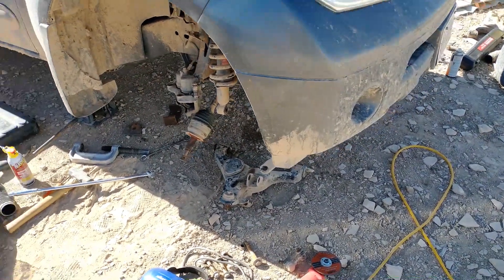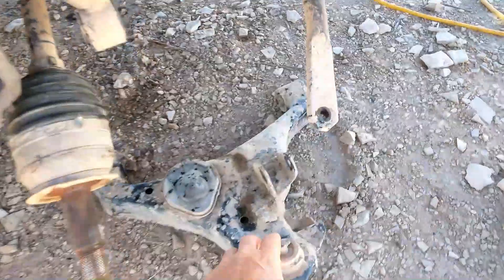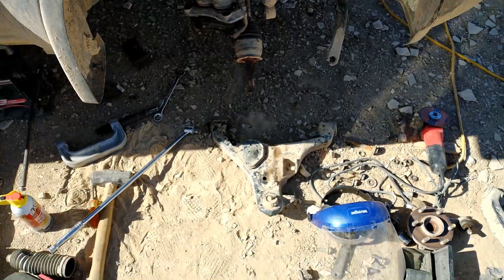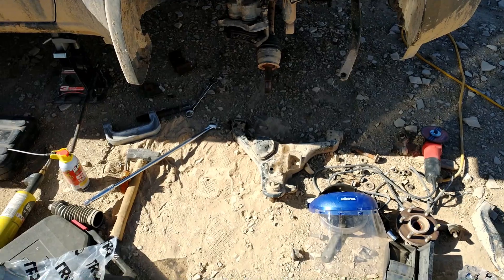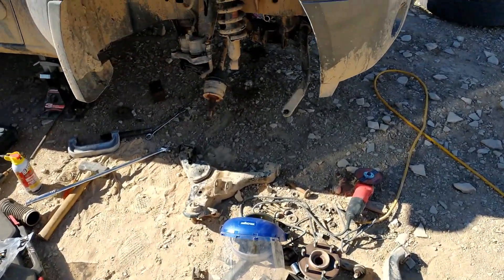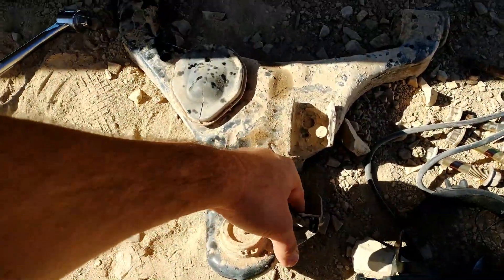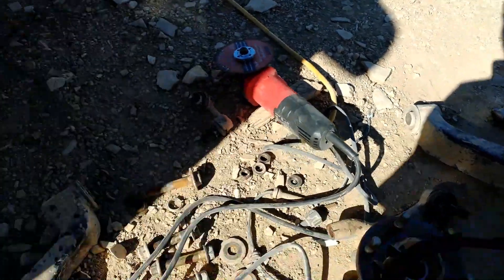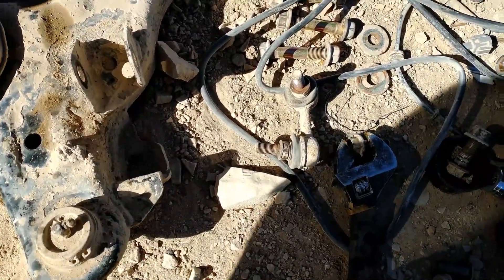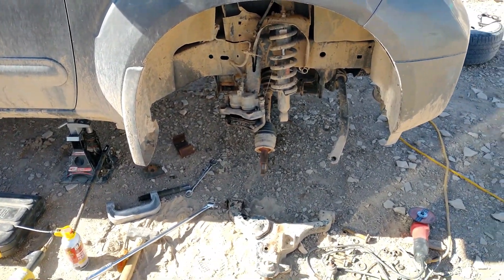Other ball joints were starting to go, and the rubber bushings in here were soft and torn, allowing a tiny bit of wobble. The vehicle has 200,000 miles on it, so that's not terrible. The sway bar end links connecting to the control arm were a little sloppy as well. So it's just a whole litany of little bits and pieces — I'm replacing everything including the axles. They don't seem too bad but with 200,000 miles on them I figure now's the time.